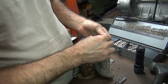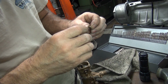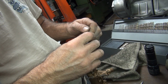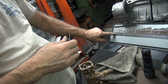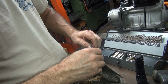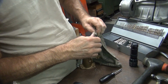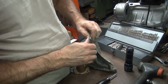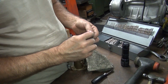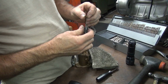I think we need to step drill it. What is that? That means we don't cut as much out in one shot. We're going from 52 to 60. It's a big chunk. See, I skipped a couple drill sizes. That thing is sharp. But that's okay. I like being rough on things. I lost it. It hasn't started yet? Oh, it's going.